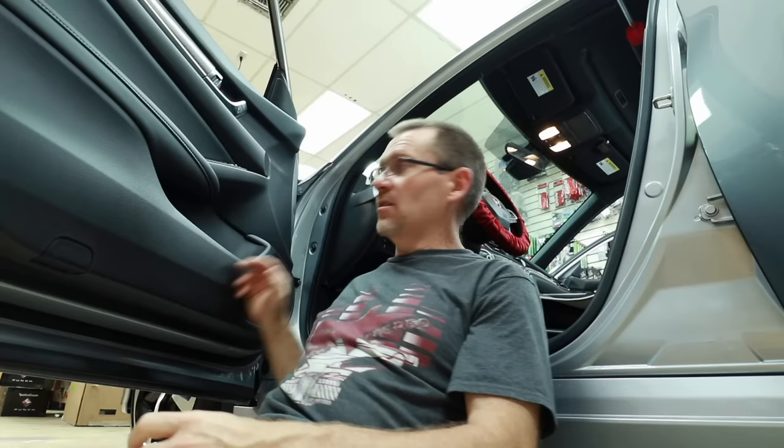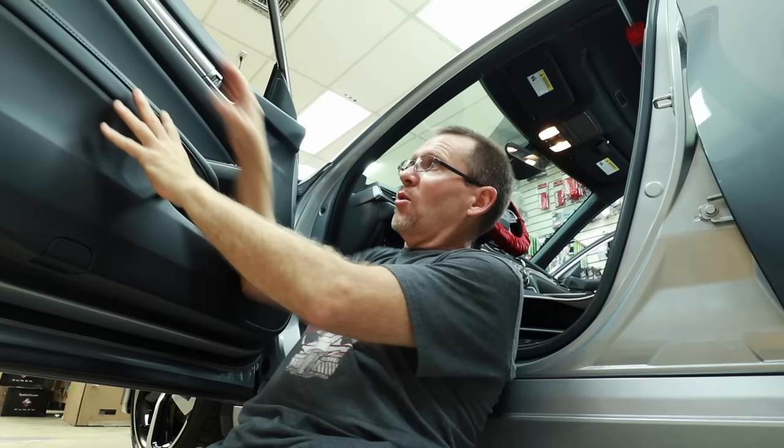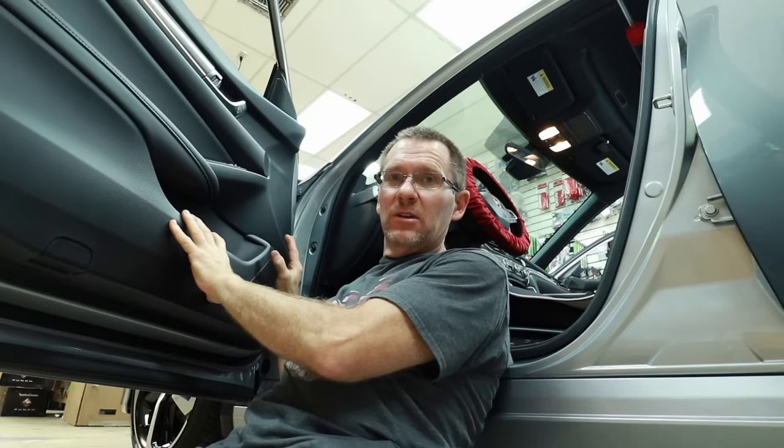One of the things we talked about with this particular customer is rattle. He realizes there's going to be a certain amount of vibration in the door and wants to eliminate that as much as possible. We're going to do a sound treatment on his door. We offer a couple different sound treatments depending on your needs; in this case he selected our premium sound treatment. That's going to consist of treating the door panel itself — covering any seams that could rattle, concentrating on the speaker mount area and behind the speaker on the exterior of the door. We're also doing the rear deck — the back side completely, along with the deck itself, using a couple different materials.